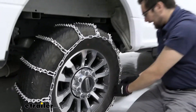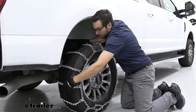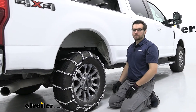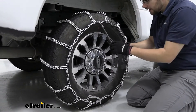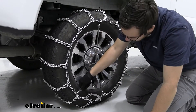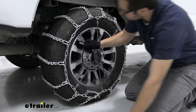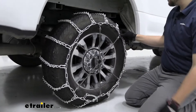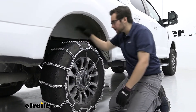That's done a pretty good job of taking a little bit of that slack out, and I'm not seeing too much movement. It's probably a pretty decent fit. But I'm going to grab a rubber tensioner just to make sure we're taking out that last little bit of slack and pulling it all towards the center of the wheel. These rubber tensioners are also sold at eTrailer.com. All we have to do is treat it much like a lug nut pattern on a tire, except with one more point of contact. We simply go down and around, distributing those forces as evenly as we can to take out all that last little bit of slack. Make sure the hooks are pointed away — we definitely don't want them digging into the sidewall of that tire. Now I have almost no movement on my chains. We're nice and secure and ready to go.